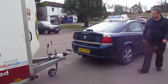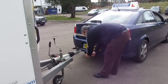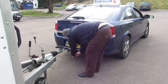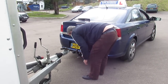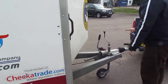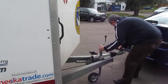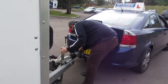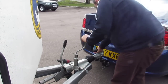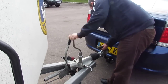So I've reversed back so far, just got to give it a check now — we're going to connect the breakaway cable. I've got it into a position that the breakaway cable can fit on, and because that's on, I can actually now release the handbrake and draw the trailer towards the car. Using anything on the trailer that I can pull forward, once I've got it into position, I reapply the handbrake to hold it in position.